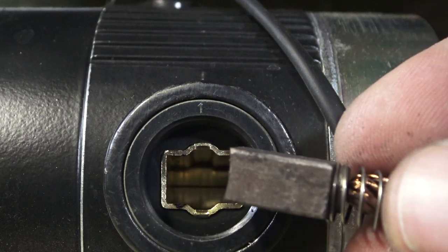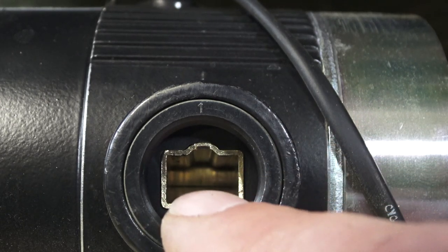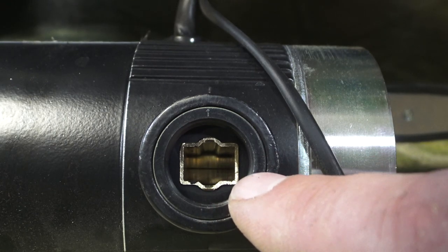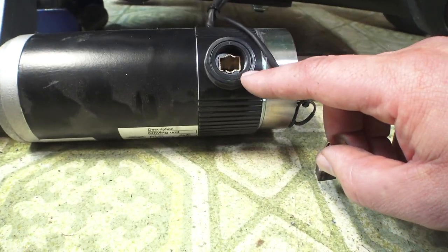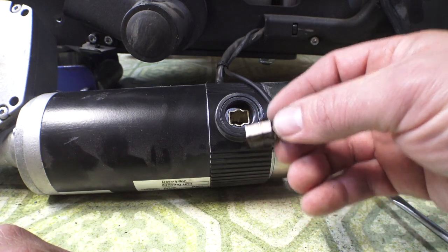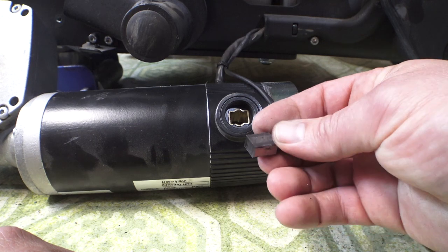There are some scratches on here, which isn't too big a deal, but the dust can get around in various spots and start making noise. The chair may still work but you need this area to be as clean as possible. A friend has this exact same chair and is experiencing low-speed power loss at about 800 miles. Judging from the amount of dust in this one, his chair probably has a lot in there. When that builds up it will insulate between the brush and the commutator and at low speeds prevent power from flowing through as easily. It'll be interesting to look at his brushes — you can usually tell what's going on by whether part of the commutator is hotter than the rest.